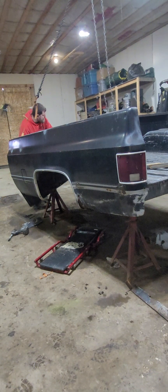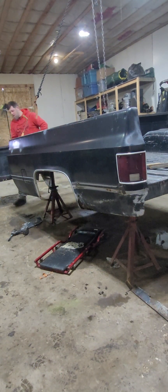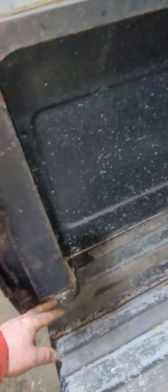There we go. What I'm going to do right here is clean all this up, clean the rust up, and put the new piece back on. Quick, easy video guys — just wanted to show you how to take the box side off. Not really that complicated, and like I said, if you wanted to completely remove the box side, you've got to cut your weld there, then you can take your box side off, put your new box side on, and you'll be golden.